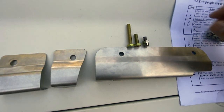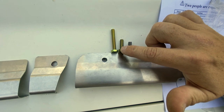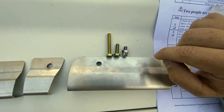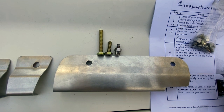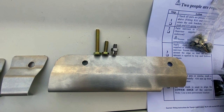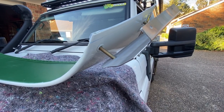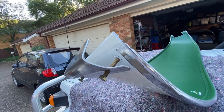The idea is that we just don't have to stretch the visor quite so much — one to two millimeters is all it really takes. These are the bolts that come with it — quite small. I'm going to start with the big ones, then move to the medium ones, and finally use the dome ones it comes with. It is for a 79 series, not a 75, and because we chopped about 8 millimeters off each side, it's easier to get started with the longer 50mm M6 bolts temporarily, then slowly move down as we tighten it up.